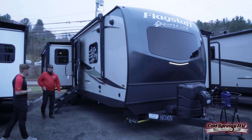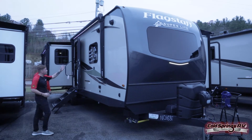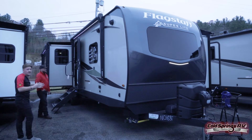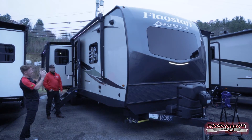Those steps are super easy — I really like those too. Another thing on the outside here is they do frameless windows, so those are basically maintenance-free. All the rubber that would normally be on the outside of these windows is actually protected by the tinted windows, so you don't have to worry about those ever cracking or leaking on you. This is your hotel on wheels — it's going to be vibrating, sitting out in the sun all day, going down the highway. Everything's going to be moving around, so having the rubber protected from cracking is going to be huge for protecting this thing over time.